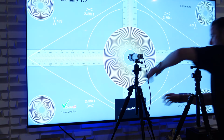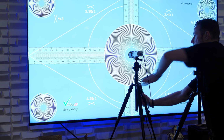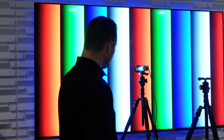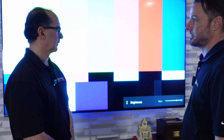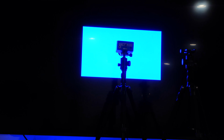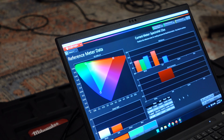And you come to a time like now and the TVs respond so much better. The results are so much better. But you do need some tools, and you do need a methodology, and you do need some knowledge of how the different technologies work. Like the way you handle an OLED versus this TV is a little bit different. In a typical ISF calibration, somebody's going to look at some test patterns like we did before, and you're going to eyeball certain settings based on the room environment where you sit. And then for the color correction, you should be taking out a light meter, taking some measurements, checking your laptop, looking at the Calman screen or color space screen if you're a color space user.